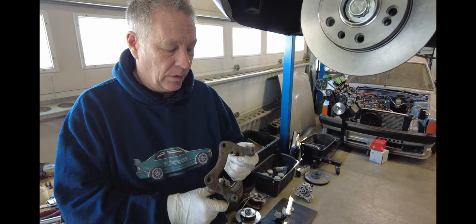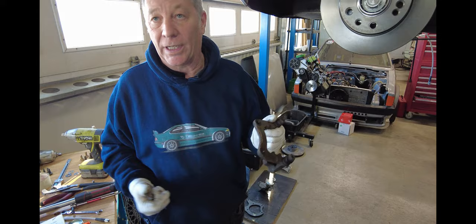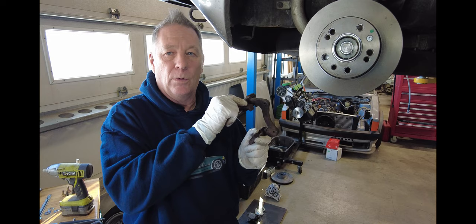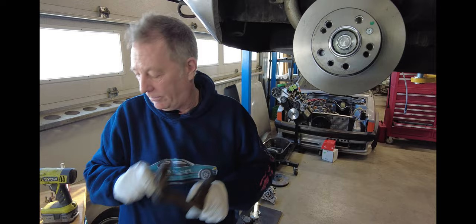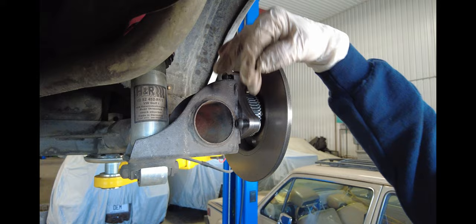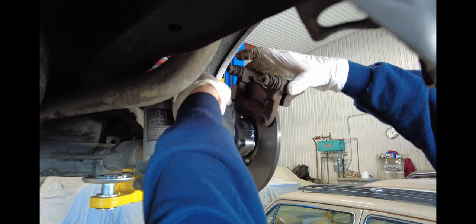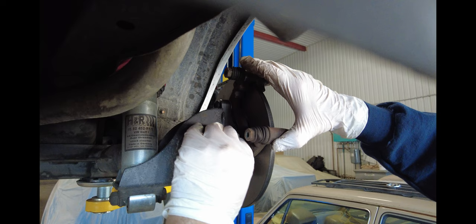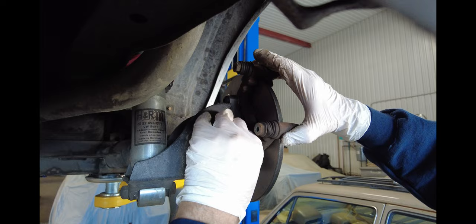Right now we have an OEM caliper carrier for the rear. Depending on the batch, sometimes the offset is a bit different, but since it's a floating caliper it doesn't matter all that much. We supply some shims — they're two millimeters thick — and this one does have to be shimmed out to be really centered. You can see the two-millimeter shims there to offset the caliper carrier outboard. We put the bolts in, put the shims in place, then slide the carrier on top slowly, do the same on the bottom, and torque them down to manufacturer specs. In the kits, they will be hex graded bolts.